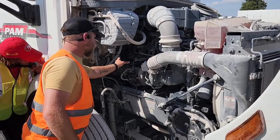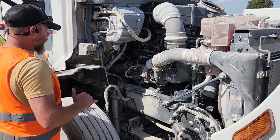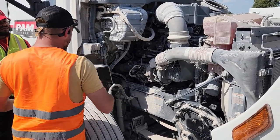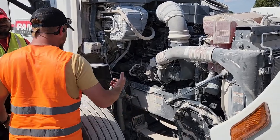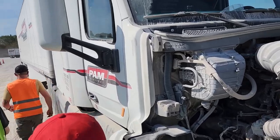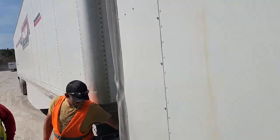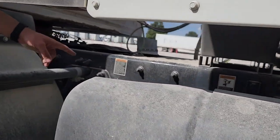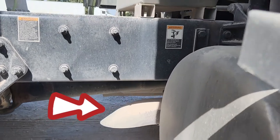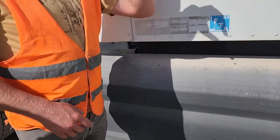Behind it is the front of your exhaust. It is properly mounted and secured, no illegal welds and no signs of black soot. It is not loose. You know, you can name off a whole list of things. Then you're gonna walk back here to the back of the truck. Back here under the frame is the back end of your exhaust, right there. You're going to tell them that it is properly mounted and secured, no illegal welds, and no signs of black soot. And we're going to go back up and around to the driver's side.